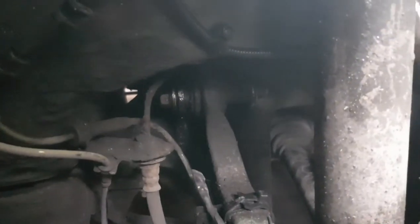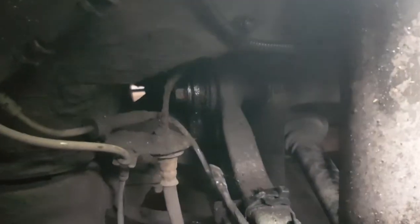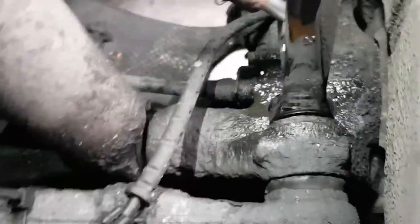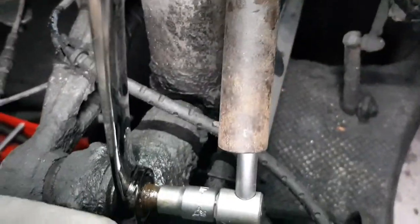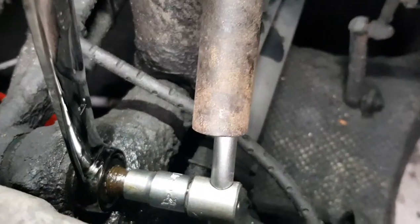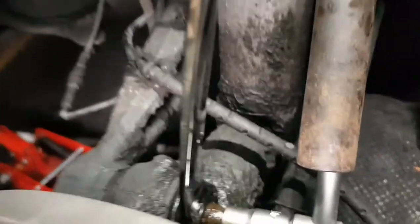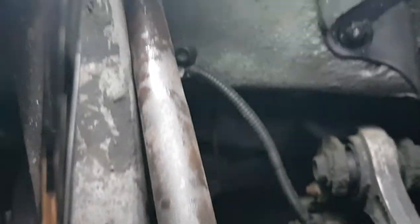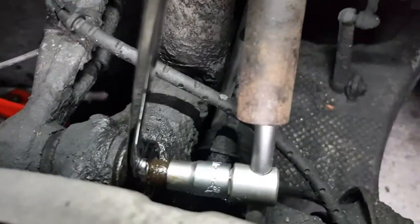Quick update — I've managed to get a few things loose here. In the inside there, basically just what I said before: small turns. You can see there's a bit of a gap there now. I've managed to get that one loose and it was just this side left. On this side I've got the 10mm socket over the end of that and I had to go in with a 21mm spanner. There's a circular finning there at the bottom, and basically I pulled the spanner towards me to loosen that nut. I was finding it hard to hold it in place, so I actually put a bar on it and tucked it up in there behind the bottom of the spring. Right or wrong, but it held it in place and then it came loose.